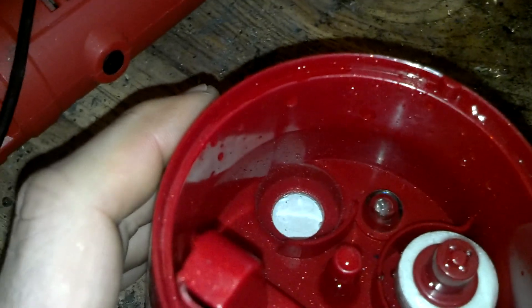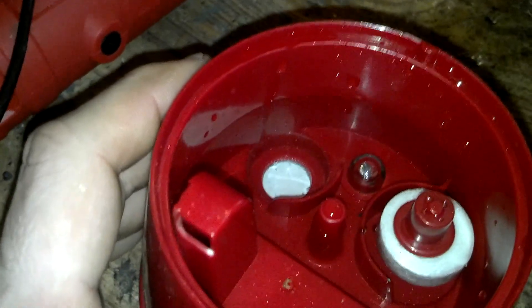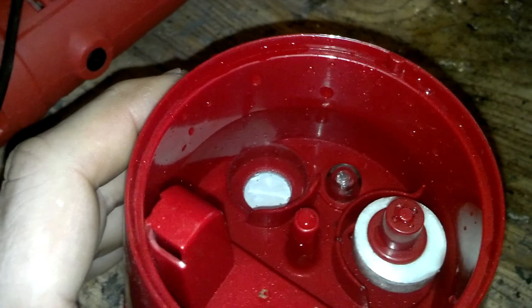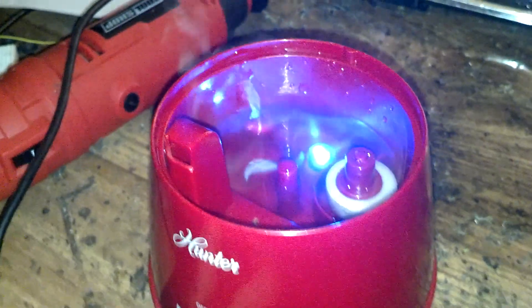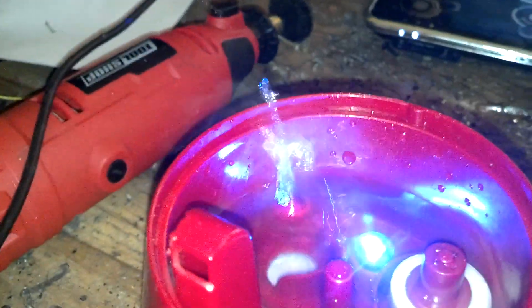You can see here there is a little floater, a styrofoam floater, and that's just simply to auto-turn the machine on and off. The piezo buzzer is down underneath the water there. So when I turn this on, it'll start trying to put a vibration through that speaker. We'll try this here, and you'll see that it's actually pushing the water up above the level of the surface.